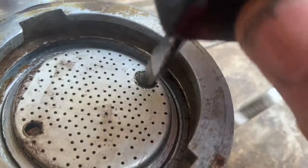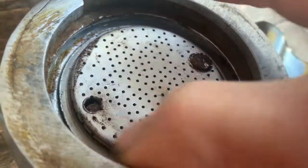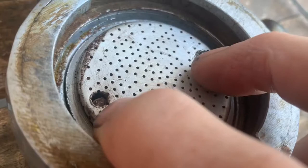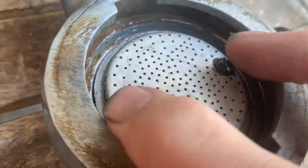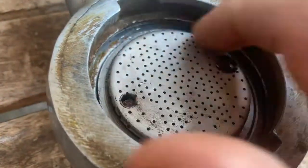Failing that I'm going to grind it out with a carbide burr just so I can get this head off, because it's going to be completely gunked up. Even if you shear both screws off it won't make any difference to the coffee, because it's actually the rubber seal inside which holds that in, not the screws. So it doesn't matter if you've got screws in there or not — it will not affect your coffee.